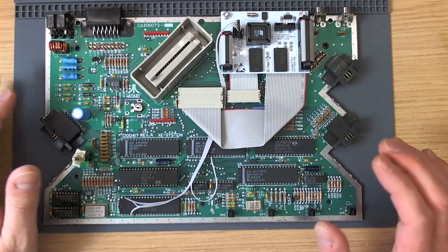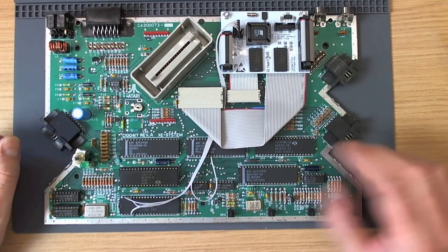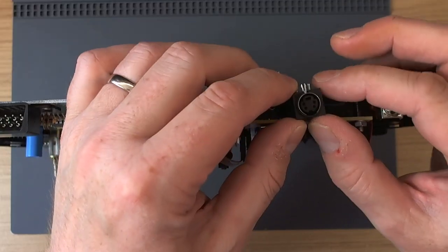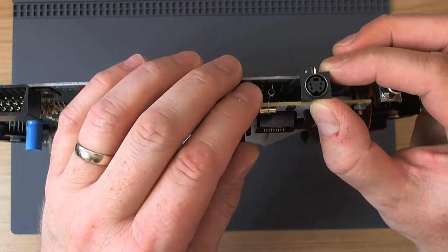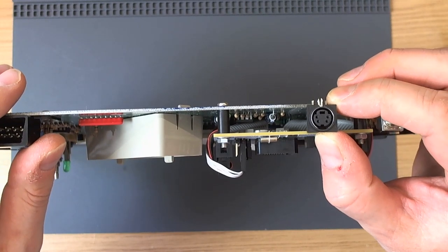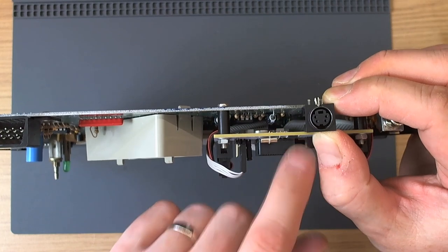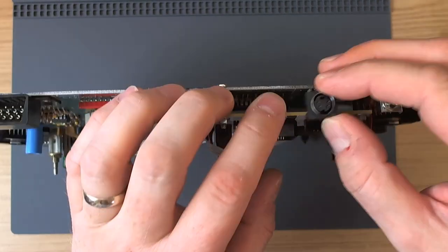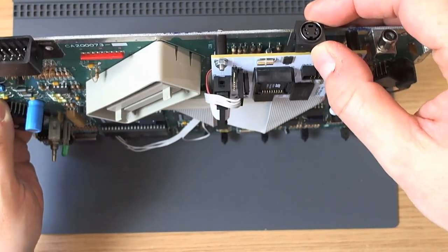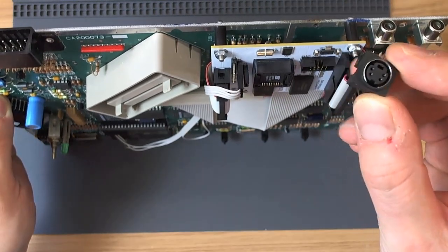Now with the machine working, the owner decided he wanted some upgrades. There are basically two things I'm doing here, one of which I've already done: installing the Ultimate One Megabyte. This S-video connector is going to go here underneath the back of the Ultimate One Megabyte. I'm not sure — I may have to make these standoffs a little bit longer unfortunately. But I've been waiting for these connectors from China. I removed the RF modulator and the connector is going to go right flat on the board, and we're going to route Chroma and Luma video to it.